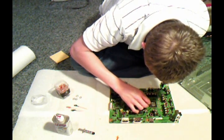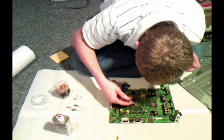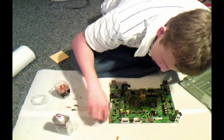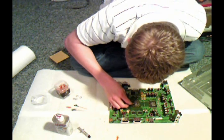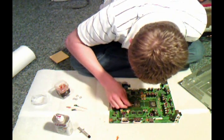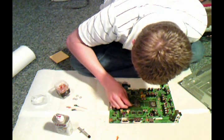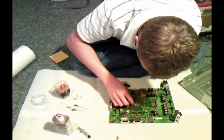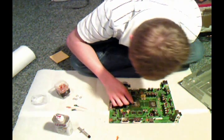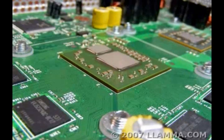I might do a little more on the CPU. Spread it around nice and even. Really be careful not to put too much — you should only have about a piece of plastic wrap thickness. It should only be about that thick.